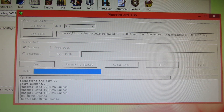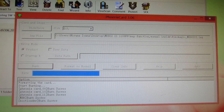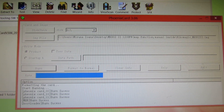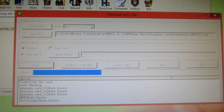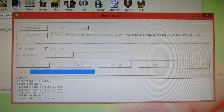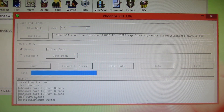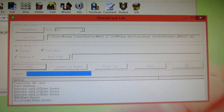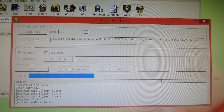After install, you put the micro SD card in the Ricomagic MK802 device. Start it and the boot will install the new firmware. You have to wait like 4 or 5 minutes. Then pull out the micro SD card and you can start it over.